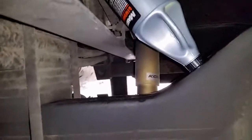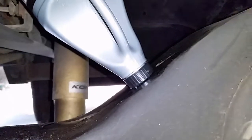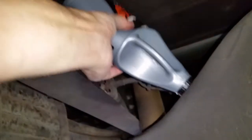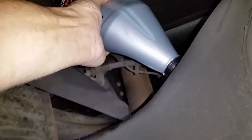I'm under the RV and I want to show you this little tip — it makes it a whole lot easier than trying to squirt the oil in through the fill hole sideways, which is always a pain and oil starts running everywhere. Just take the vent loose from the top and fill it from above. You can take a razor blade and cut right about this line so you've got a nice big hole in the container. Then all you've got to do is give it a few squeezes and quickly pump it in there. That makes quick work of getting the oil in. There's one quart down and about six or seven more to go.